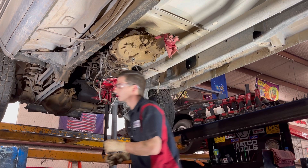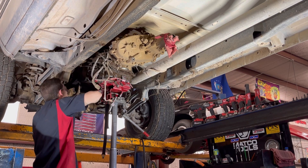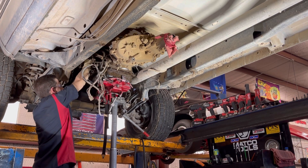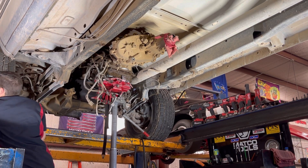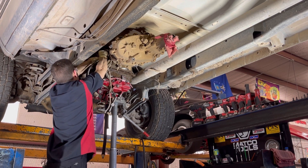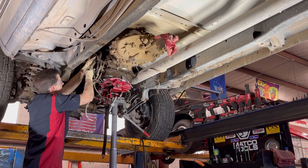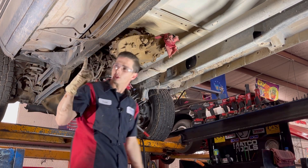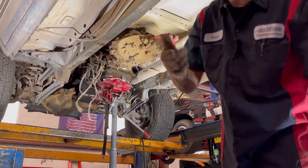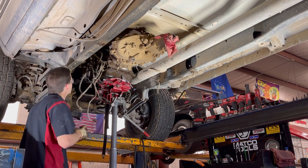It's just a walk in the park - I really like these but there's just a lot to them. Dodge was still trying to figure out how to organize everything, which I think was everybody back in the day. They're getting there - a lot of electronics but they're consolidating things. Our connector is totally full of fluid - I just touched it and my finger is wet. That's a sign the main harness in the transmission needs to be replaced.